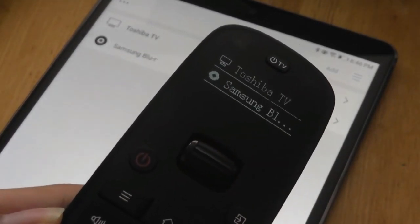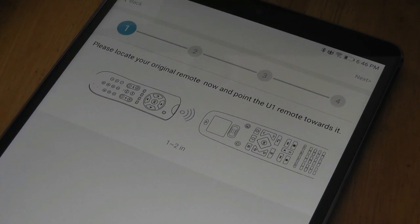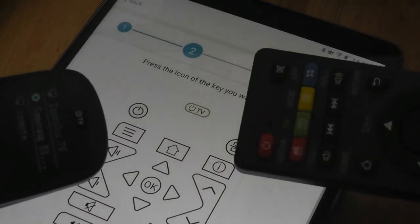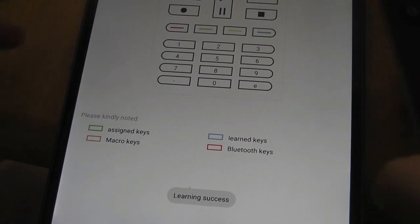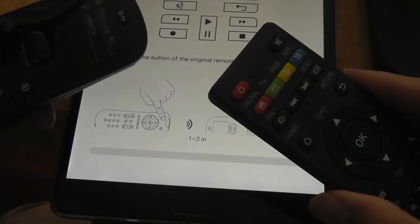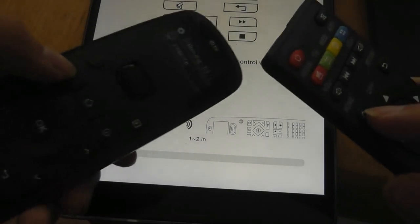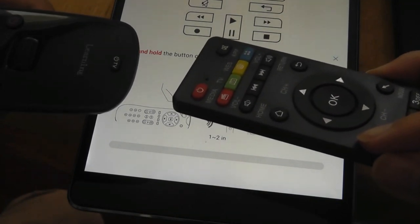Let's try adding a third device — a more generic TV box or streaming box. This time we'll use IR learning mode completely. Locating the original remote for our generic Android TV box, we point it at the U1 remote, tap next, then press the icon of the key we want to learn. After a few seconds it should learn that command. It's a bit more tedious to learn keys one at a time — we've already added two D-pad keys. With that said, it won't work 100% of the time; you'll occasionally get failures. For example, trying to learn the home key, which takes us to the home page of the Android TV box, you can reach a certain point and then sometimes it says 'learning failed.'